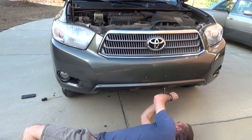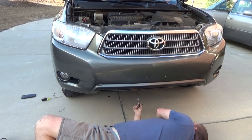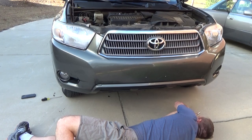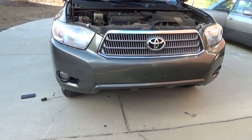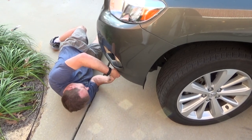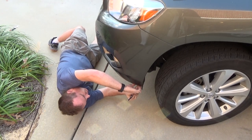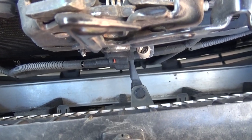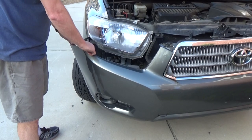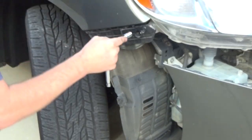You do need to go pretty much all the way across the grille — in this case, to the driver's side of the grille — but you don't have to go past that. You don't have to get into the fender well area over there, though you can and it'll make it a little bit easier. There's one last bolt you can take out right here, but you do not have to come up the fender well and take out the screw and plug like on the passenger side. This will give you plenty of flexibility. Between the grille and the frame, you'll need to pop out one more plug — just stick a screwdriver down there and you can get it out. And then look, this whole bumper comes away, and now you see why we took some of those screws out — it just lets you get the bumper with enough freedom to get in here.